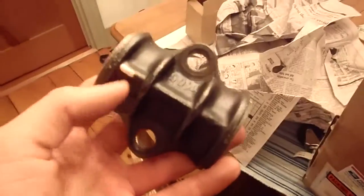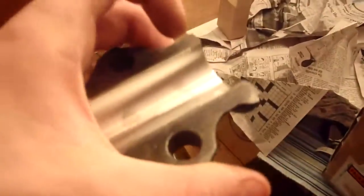Now the reason I bought this is because my crankshaft has a lot of thrust in it, and this is what controls the thrust. It runs fine, but the crankshaft has so much thrust that the magneto ring back there has moved back from the coils, so it doesn't generate adequate power to run the engine. So I've been running it off a battery. But now when I have this, I can throw that in there and it'll run good because the magneto will be back up close to generating the right amount of power.